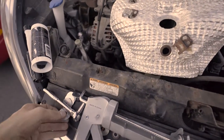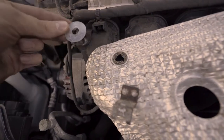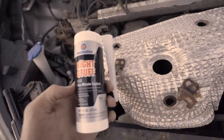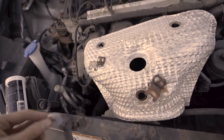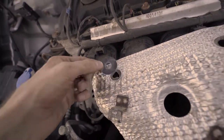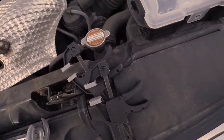Which will probably cost you more than the cost of this fix altogether. First thing we're gonna do is grab some nice big washers that'll fit right over the hole, and some RTV. Basically what I'm gonna do is sandwich washers on each side of the exhaust gasket, RTV them in place, and hold them in place with clamps until they've solidified.